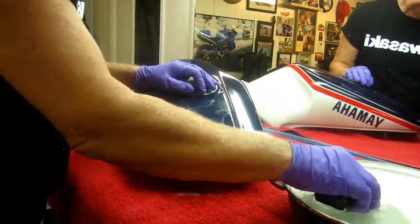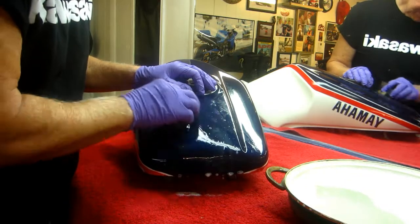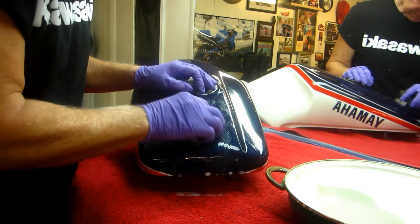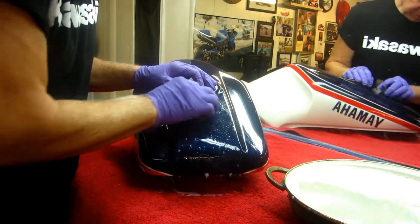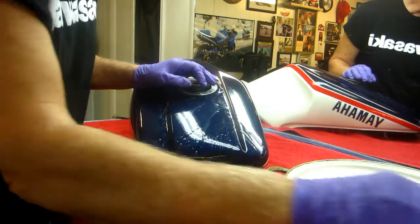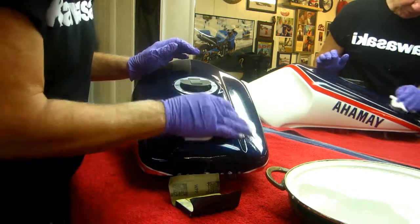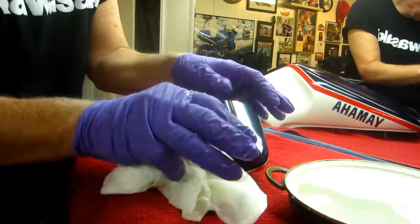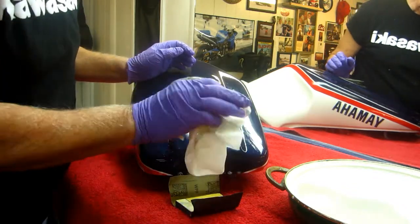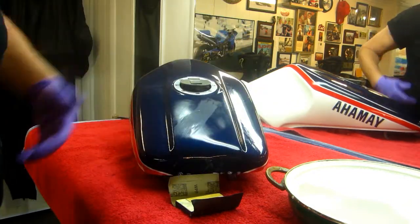Now I know I definitely have to sand all the blue. So I'm going to have to basically block sand all the blue here. See, I'm already coming through. So I wanted to show this because, even though I've got it flat, the blue is, we're going right through into the white here. Where the paint made a mountaintop, the mountaintop is white. I don't know if that makes sense to somebody that's not a painter, but this is pretty atypical of how you do these repairs.